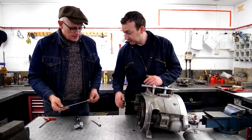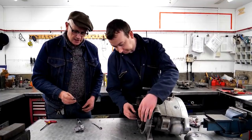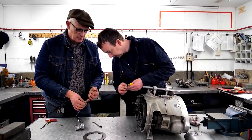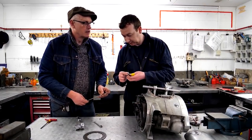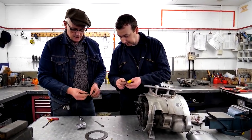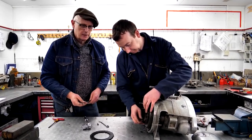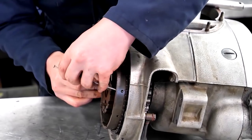That'll get checked in case there's any warps or bends in it. The rod is hardened on either end. In fact, this one is quite sharp on the end — it looks like the hardening might have started to go a bit, with a dish forming in the end of it, possibly from where it's sat. It's got an imprint there for the ball bearing. The problem is once that hardening really does go, that will wear out in no time at all. You think, oh the clutch is getting a bit loose, and then five minutes later you can't ride the bike. So a magnet is essential for getting these out — it's really hard to get them out any other way.